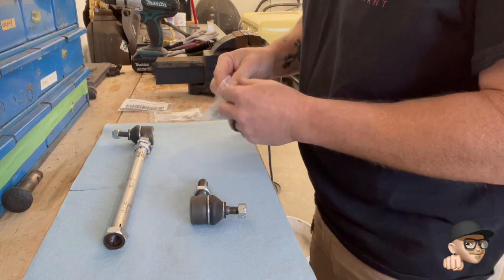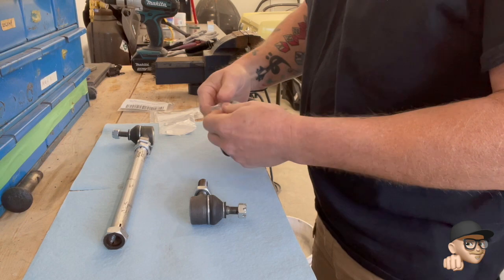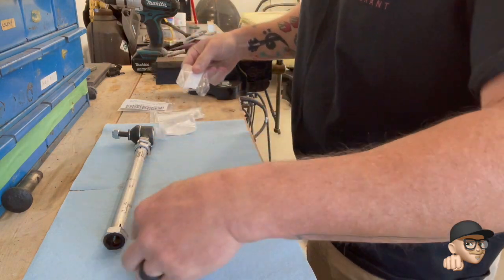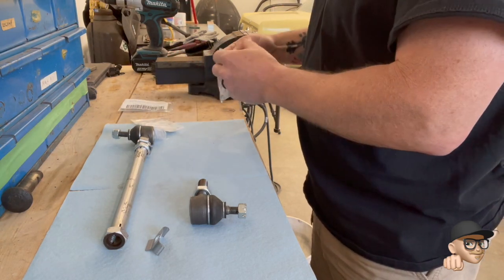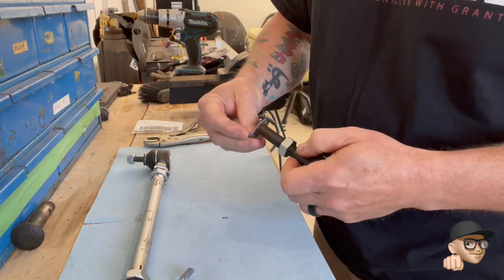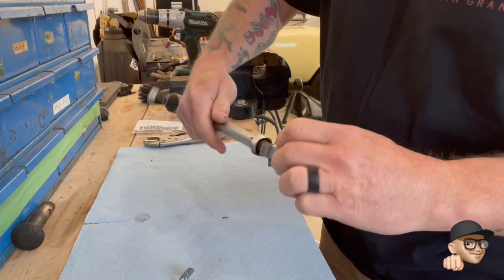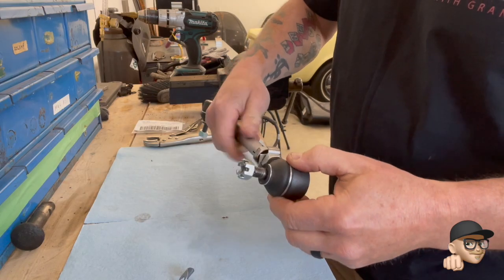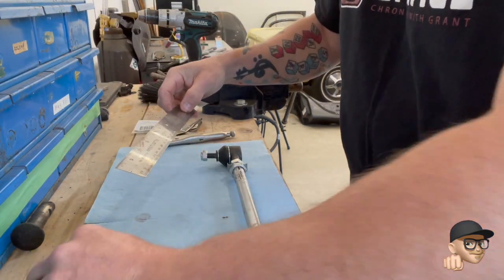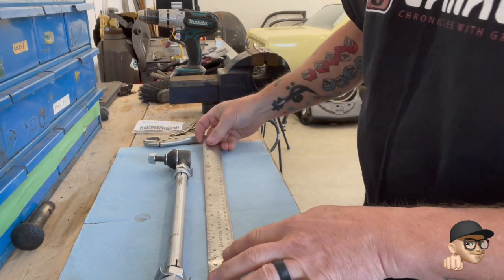Here we are putting the steering together. This was not as challenging as I thought it would be — I just measured everything beforehand when I took it apart, so I can roughly put it back together. In hindsight it probably doesn't matter that much, because once I put everything together I have to move everything and make adjustments anyway. The car is going to be sitting at a slightly different ride height, and any time you adjust your suspension you need to do an alignment. I bought new locking tabs and I'll leave those unfolded until the car is properly aligned, or close enough to get to the alignment shop.